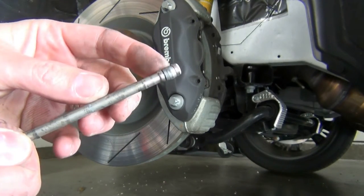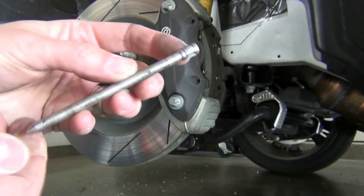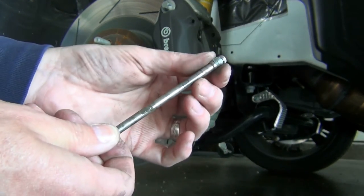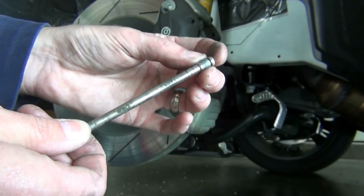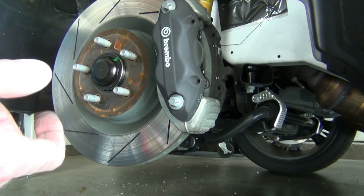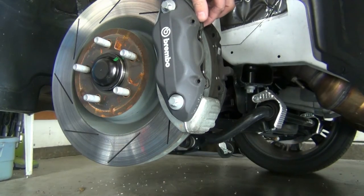Here's how these pins stay in: you have a little elongated piece which is the tension point, so it's not too stiff all the way in. Same length, but you have this extra little piece which compresses — that's where it locks in place in the back, right where you tap in the last bit. That's what locks it solid.